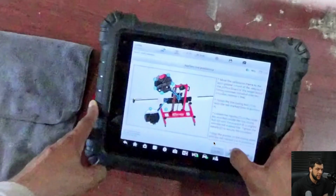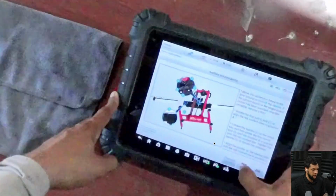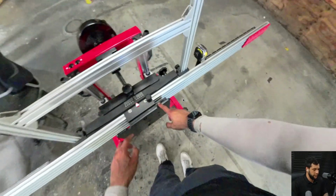So here, first of all, it's telling me to put everything back to the origin position, because if you're doing calibrations on different cars, you might forget to adjust it back to the origin point, and then you're gonna have wrong measurements and your calibration will not be performed well. So it's always good, before everything else, to set everything back to the point zero position, okay? The origin position. So let me zoom out so you guys can see better what I'm doing.